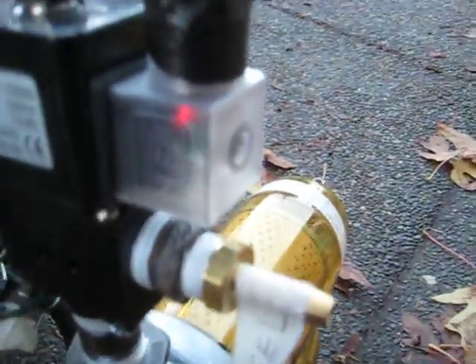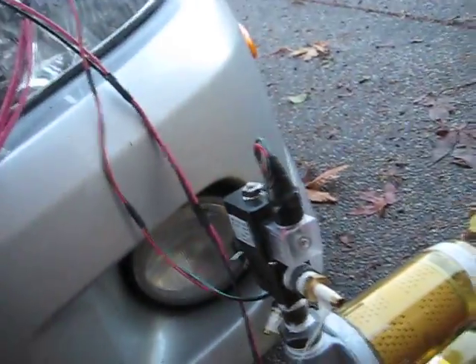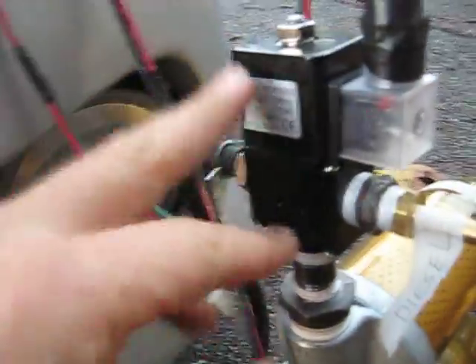Right now I'm trying to blow on that, but it can't blow — but as soon as I connect the switch, see that light goes on, right now I'm blowing through. I turn it off, done. So that just shows you how the solenoid valve works. I always like to test everything out with air.